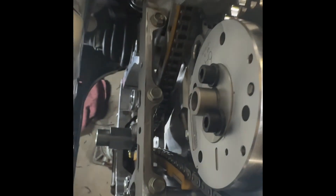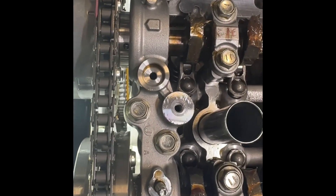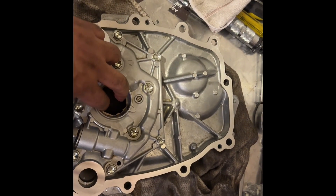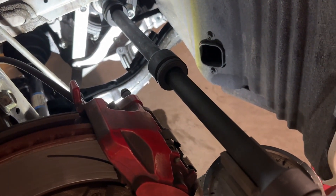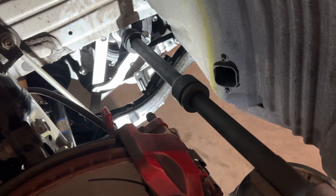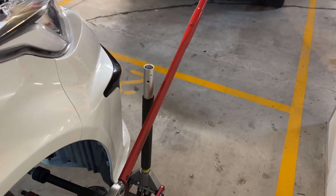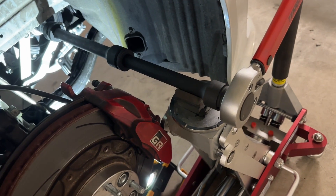The case interfaces are all cleaned up and ready for the case covers. Installation timing marks: pink links, slots on the hub assemblies lined up with the caps. You can see the lower case, oil pump in the bottom, oil pump drive, and the top case. For the crank hub bolt tightening, use a proper three-quarter inch drive, a proper reaction tool, proper support, and a massive torque wrench — the same one I used for my GT3 centre lock wheels. I had to buy three-quarter inch extensions, but well worth it.